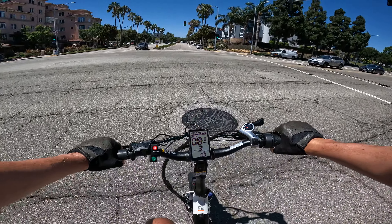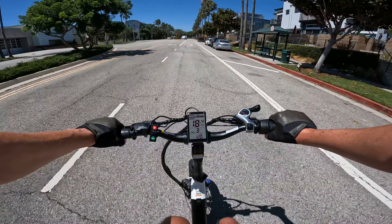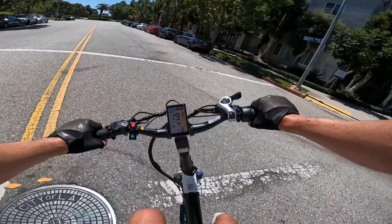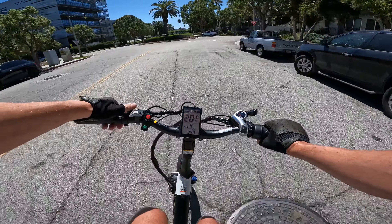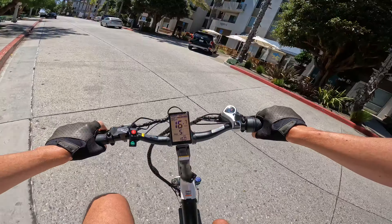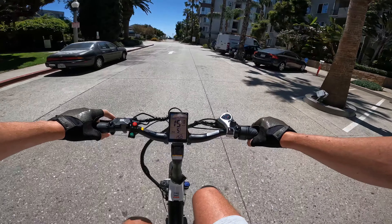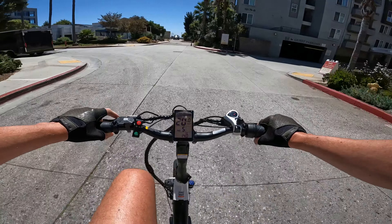One more bump puts current at about 17 amps — a nimble feeling cargo bike when it's not loaded up, taking us to about 20. This bike appears to be limited to 20 out of the box. On pedal assist five with throttle, we see about 16 amps of current. With a little ghost pedaling, it hard-limits us at 20 out of the box. Brakes are confidence-inspiring.